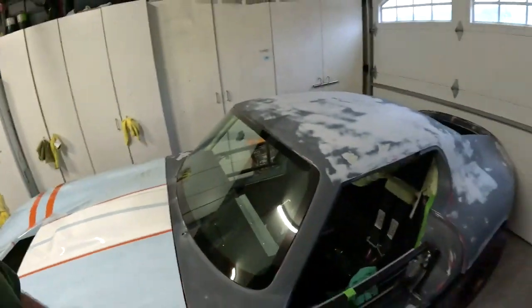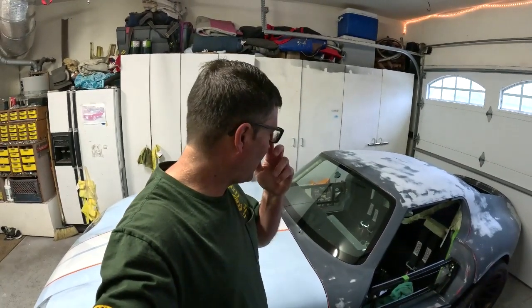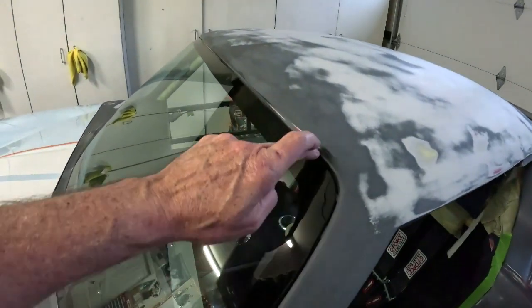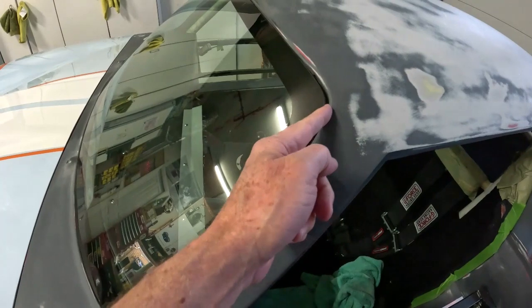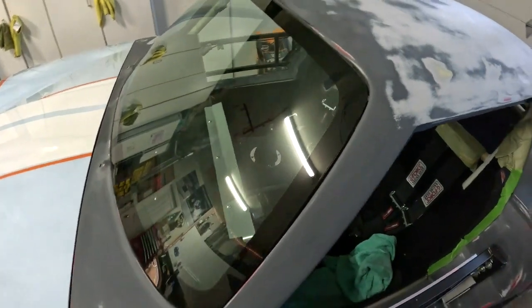Another thing that's going to make the pros cringe — I'm not pulling the windshield glass out. A pro glass guy could get it out and back in no problem, but I don't want to risk it. My buddy Dave and I put it in and it went in really well — I don't want to mess with it. What I'm going to do is try to get paint down inside the gap, and then 3M makes a product to fill that gap. I'll tape the edge off, shoot it with the rubbery black stuff you see on show cars, fill the gap after it's all painted and cured — and you'll never notice.